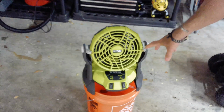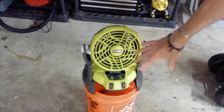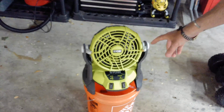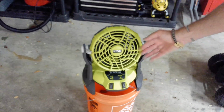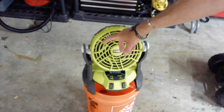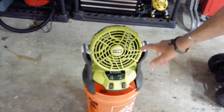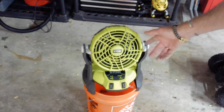In conclusion, you are going to need to play around with the misting jets. I was thinking that with the misting on its highest setting and the fan on the low speed, you might get a lot of water being thrown out on the floor. Not everything is necessarily evaporating, but it's actually better with the misting set on the higher speed, because the pressure on the jets causes more mist to come out, whereas on the lower pressure it was wanting to maybe just be spraying almost a stream of water out, particularly from this left one here. But certainly on the higher setting for the fan and the misting pump, that is icy cold air coming out of there. Absolutely outstanding, and no doubt at all this is going to keep my garage nice and cool on a nice hot day like it's due to be today.